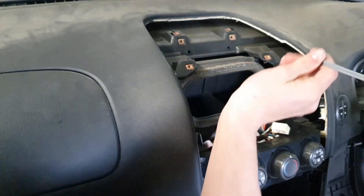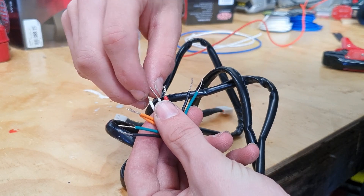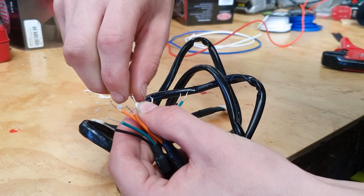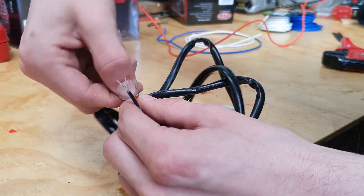It's not necessary to remove the head unit but it does make it a lot easier. I used a snake to pull the wires up to the top and also decided to run another grounding wire up here. Both of these gauges have the same basic wiring diagram: orange wire is 12 volt constant, red wire is ignition 12 volt, white wire is dash 12 volt, black wire is vehicle ground, and the green wire goes to the gauge's sensor.